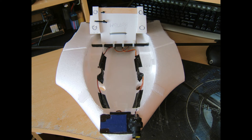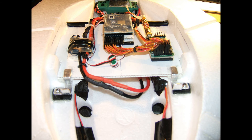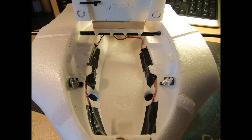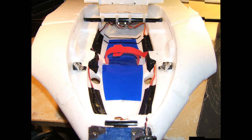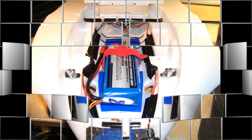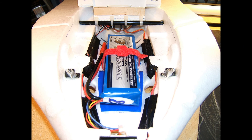Everything seems to have just worked out fine. The two cables you can see, one down either side — one is the feed for the camera and the other is the supply for a high-intensity LED that I've got mounted on the front of the aircraft, which will be useful for seeing the thing coming back towards me. I used the silicone gel sheet to stop the battery moving around, along with a velcro strap. Together they do a great job and allow me to move the battery depending on payload to get the CG correct.